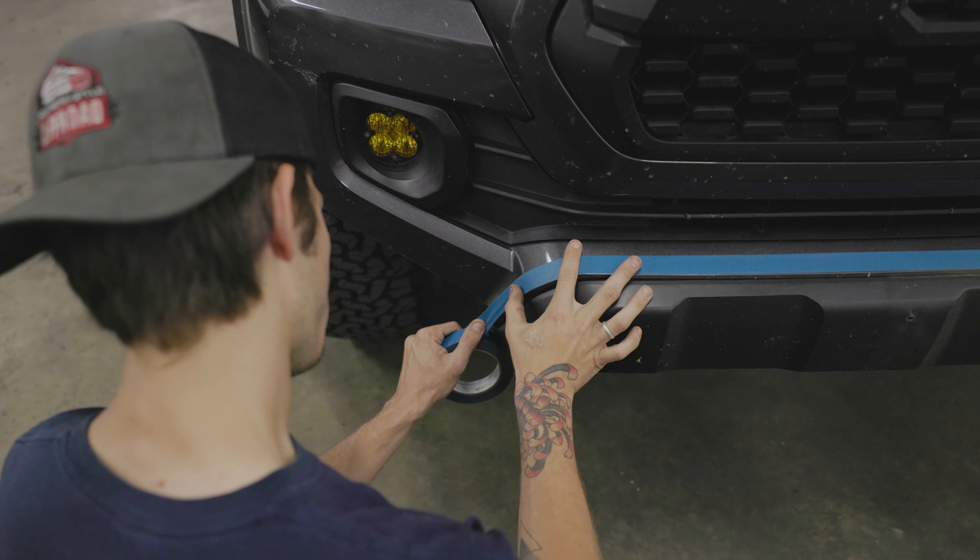To get started, go ahead and grab your one inch masking tape. I usually like to start in the middle of the bumper. You're going to want to get one side of the edge on this top line above the valence and just follow that line all the way down. Getting to the edge right here is a little tricky because your tape might want to buckle up on you. Then just tear it off like that. This customer already has a viper cut done right here but that's not really going to affect what we're doing.